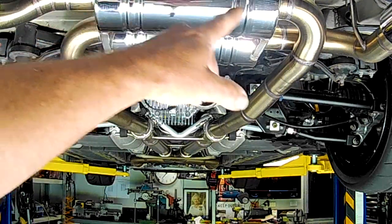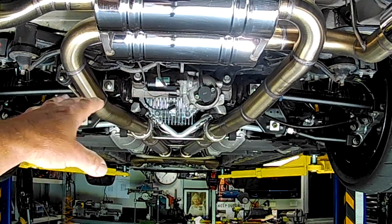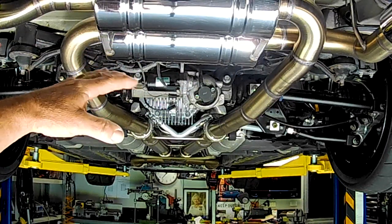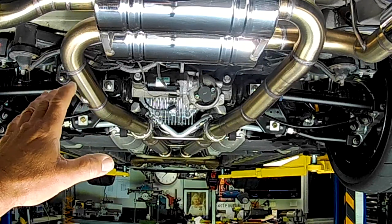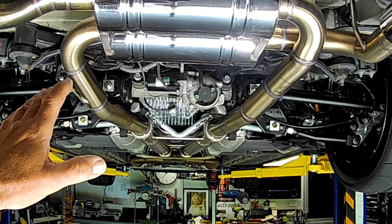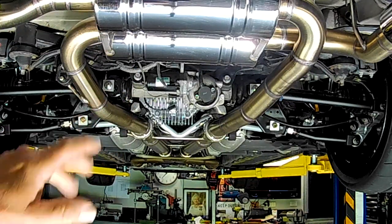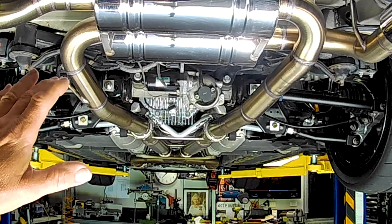In my opinion, this would be a dead zone in behind the differential and where the mufflers and everything are. Air would just scoot underneath and possibly roll around slowly in there, or just be a complete dead zone. So what I'm about to do is make a little bit of a scoop to feed air up over the cooling fins on the cover here. So we'll go in and I'll show you some of the templates I've made out of cardboard.